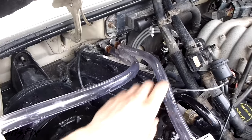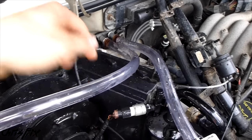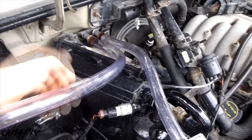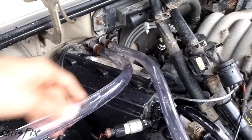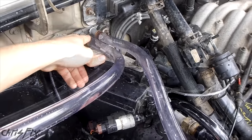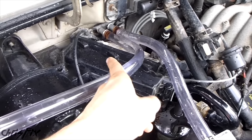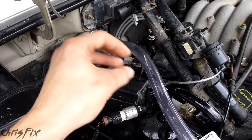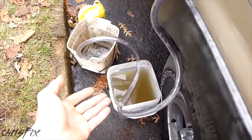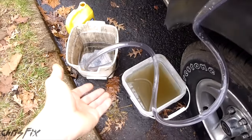The other option: let's say you had flow like I just did, but your heater core was really dirty and the water wasn't clear yet, or you didn't have great flow. Well, what you could do is reverse these hoses. So you just flushed it in reverse — now flip the hoses around and flush it through the other way, then flip them again and flush it back the opposite way. So you're going to do a reverse flush, a normal flush, and then a reverse flush. That should really mix up all the debris in there and get it flushed out. My system wasn't bad — got all that gunk out and then the water ran nice and clear with good flow the whole time.